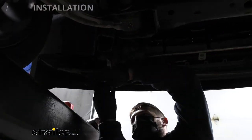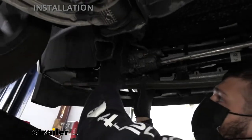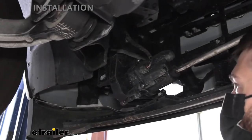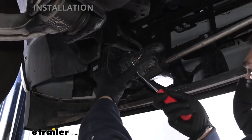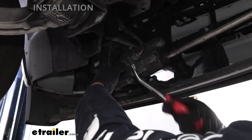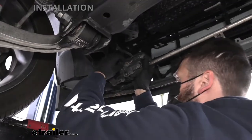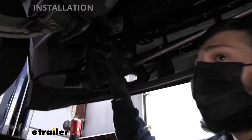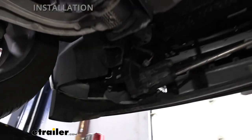Here's what the nuts look like. We should be able to pry the motor off the studs. Once we have the motor loose from those two studs, we're going to remove the connector from the motor — just pry back that lock, then depress it and pull out. After that, we're going to jump to the other side, remove those same two nuts, and this entire assembly will come off the vehicle.